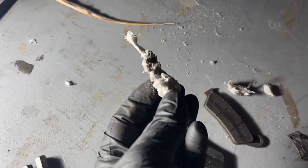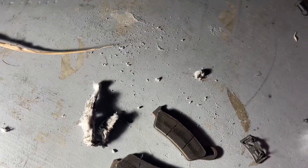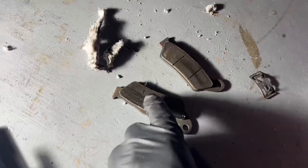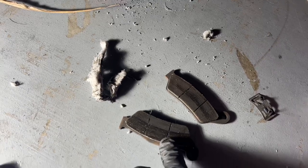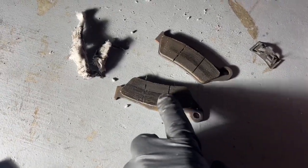Well, this explains a lot — a lot of this plastic right here is just literally solidified and it's all jammed up between the pads and hung up inside the caliper. I can see some literally shining here on these, so I'm gonna rough this up a little bit, rough up the actual disc itself, and put this thing back together.